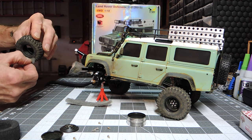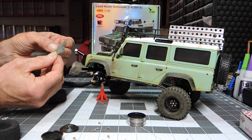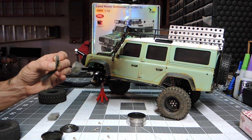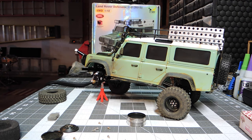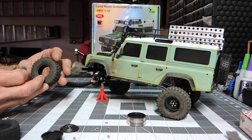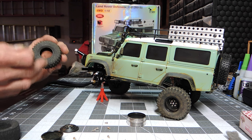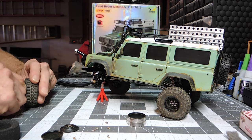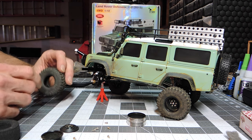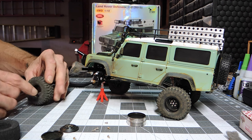This might do, but that's almost a little on the small side — I want a little bit more. Even a little bit of overlap on either side, once it's laying in there, it doesn't matter, just as long as it's there. Because if it's not there, it creates a soft spot — a flat soft spot in the tire. As long as this is there, it won't do that. So you find that spot and just simply lay and press it right into where it needs to be, and it won't move.